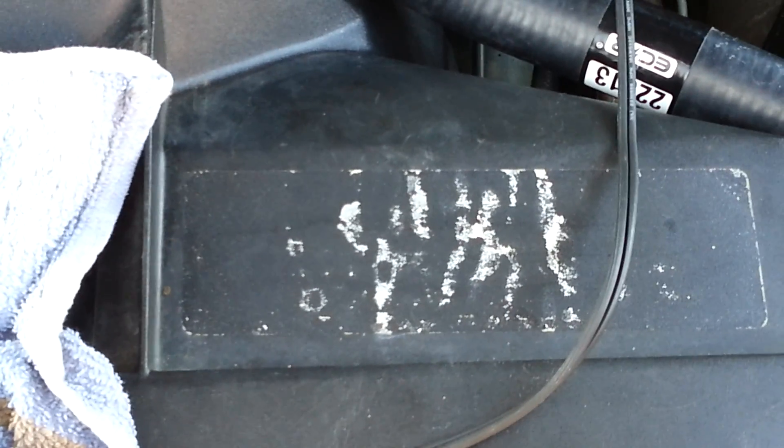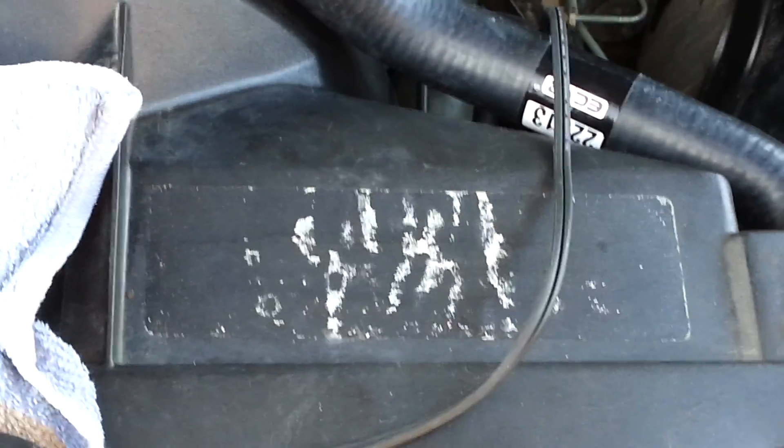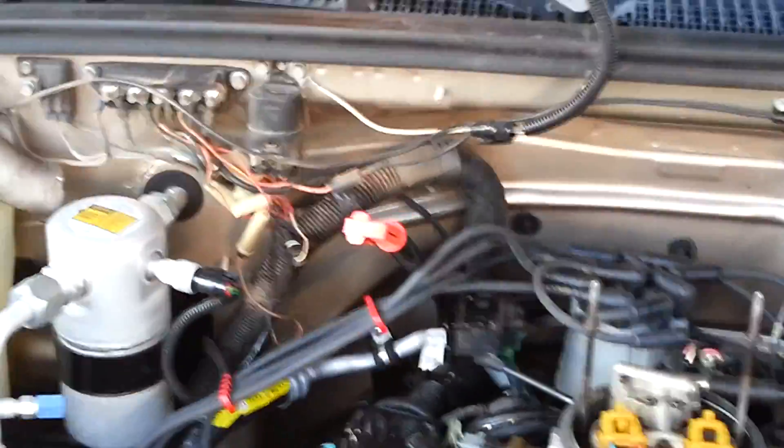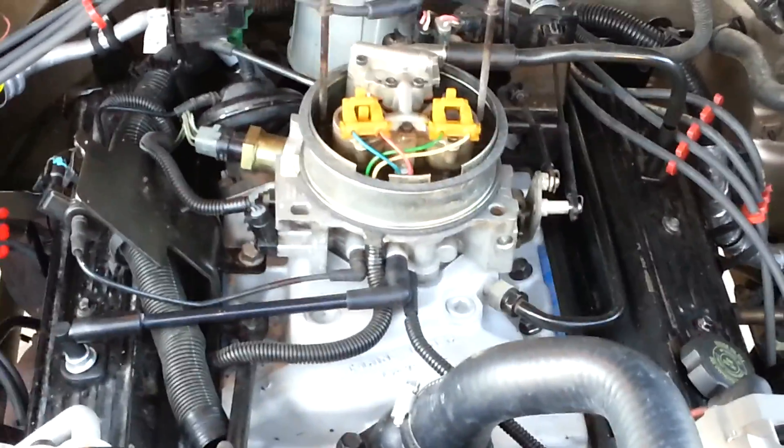With the timing light on, you don't see the white line marker on your harmonic balancer because it's underneath the timing marks where we can't see it — so it's at 20 degrees advance, which is what the computer sets these to. There's a sticker that's normally on the fan shroud — this one's completely gone — and that'll tell you if your timing is supposed to be set at zero degrees. This one is set at zero degrees with the timing advance connection disconnected, then once reconnected it's actually at 20 degrees advance. That's how you properly set your timing on a 1993 Chevy 350 5.7 liter throttle body injection.